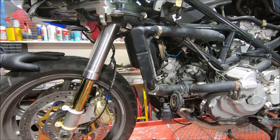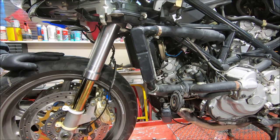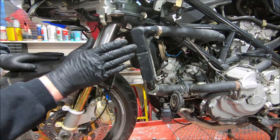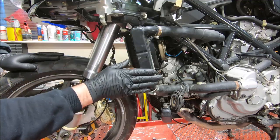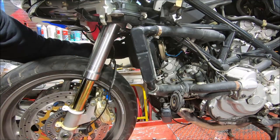When it gets to about the thermostat opening temperature, it should be around about 65–70 degrees. On this ST4S it showed 68 when the temperature stopped rising and you could feel the thermostat open. You'll feel this part here get hot, and the right hand tank also get hot.